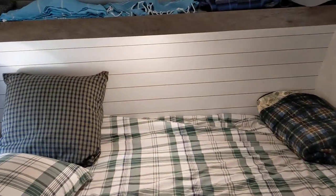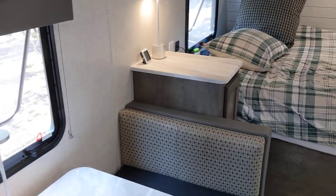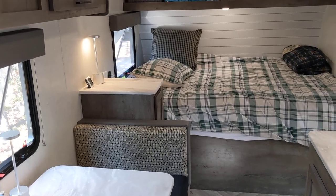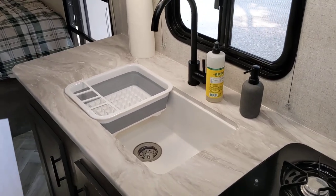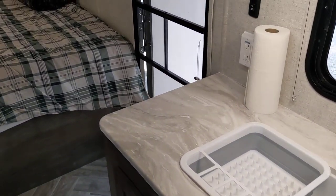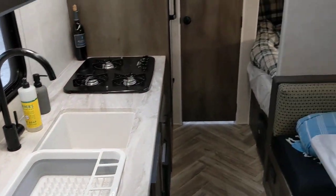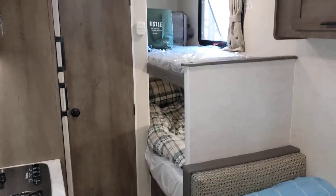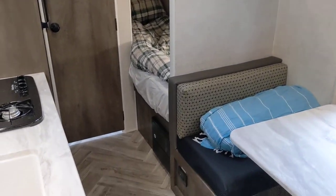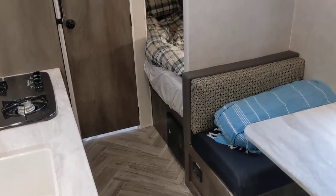Let me give you some numbers. The dry weight of the trailer is 3,265 pounds; additional cargo you can carry is 1,551 pounds, for a total of 4,816 pounds. If you fill the fresh water and hot water tanks — a total of 48 gallons — that weighs about 398 pounds. So almost 400 pounds is used up if you fill those tanks. If you can, it's obviously much better not to travel with the water full. Fill it up when you arrive at your campsite.